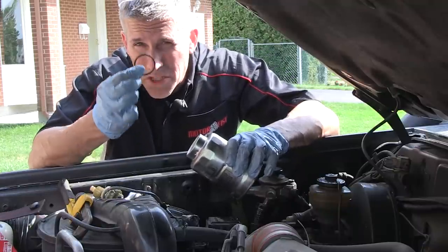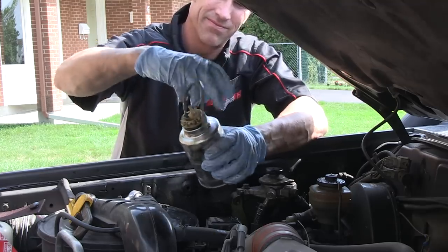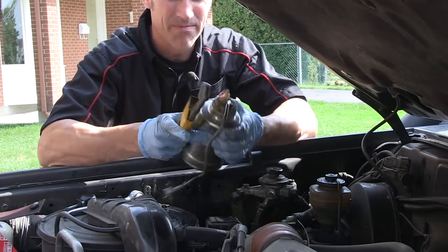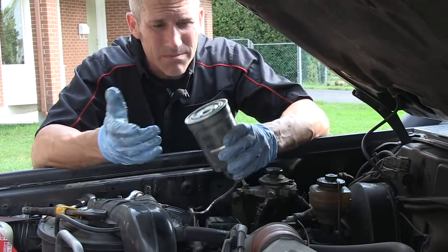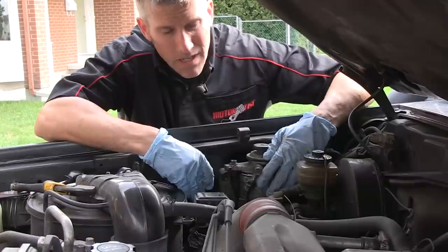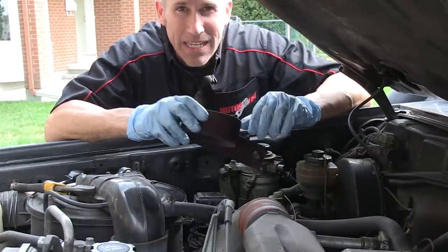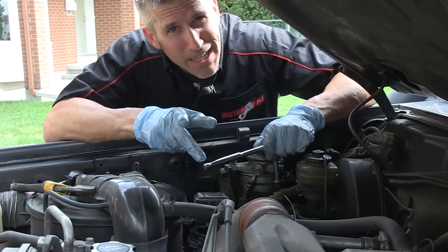Toyota always supplies a fuel sender o-ring, so make sure you use it. When you put it on, just lube it up a little bit with diesel fuel and it'll get a nice tight seal. Make sure not to over tighten it. Also make sure that this seal here is a little wet with diesel. Now I'll spin the filter on, but make sure that this little wire here for the sedimenter sender doesn't get all twisted up. I'll use my strap to tighten it just because I can't really get my hand in there to give it a good torque — not too tight, just a little snug, you've got to be able to get this thing off.